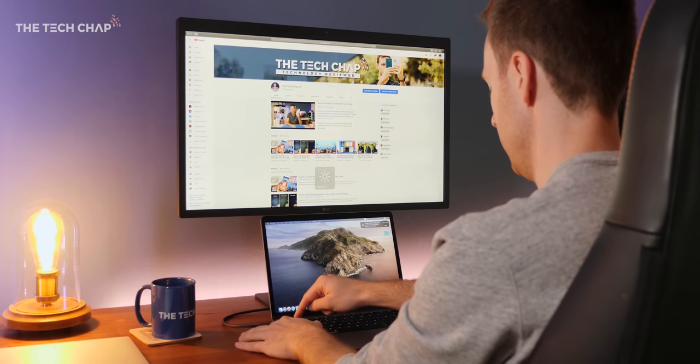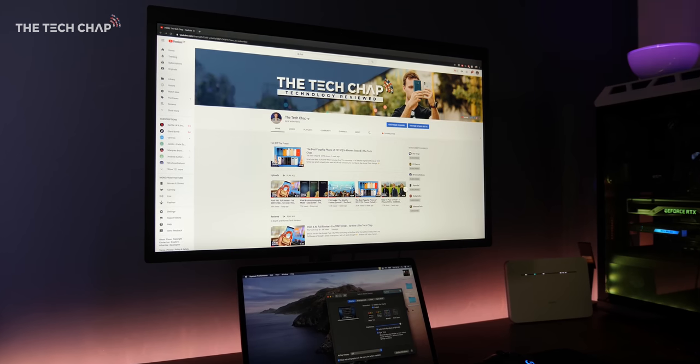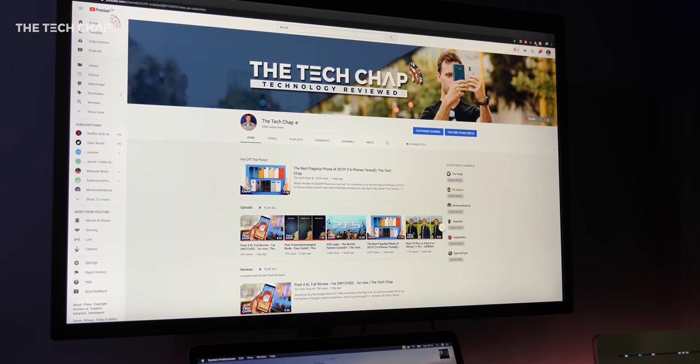One of the cool features if you are using a Mac is you can use keyboard shortcuts — or the touch bar if you've got a fancy MacBook Pro — to adjust the brightness and volume on the monitor. Normally I can just press the brightness key and that changes the laptop screen; if I hold Control and do the same thing, it adjusts it on the monitor itself. Same thing for the sound. It also works with the True Tone Ambient Light Sensor on your MacBook and adjusts the screen based on the lighting around you. You can turn this off on your Mac if you're doing color-sensitive work, and it doesn't work if you're using this with the laptop screen closed.